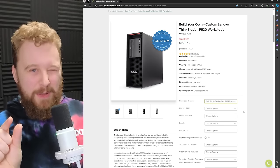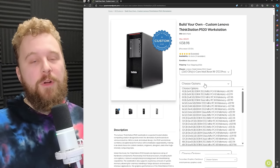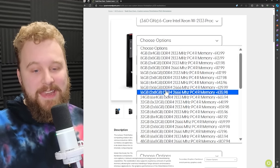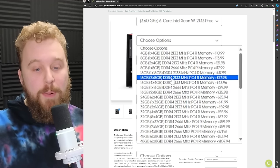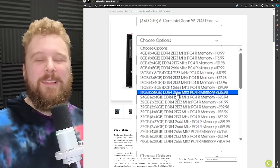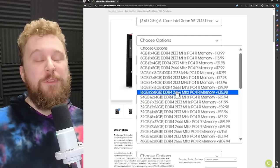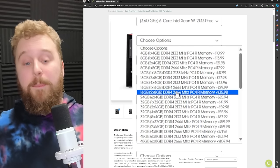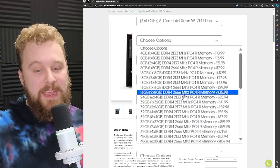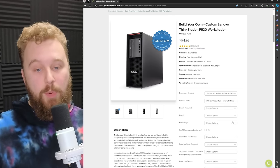The 2133 is slightly different from what we have, and you might have slightly worse performance, but you'll save a good amount of money. For RAM, in 2024 you want at least 16 gigs. The best way is getting 2x8 sticks of DDR4 2133 memory. You can go a bit higher — with these Xeons you won't see a major performance uplift from faster memory, but since we saved money on the slower Xeon, we can get some faster memory. DDR4 2666 would be my recommendation, giving you 2x8GB for 16 gigs total.